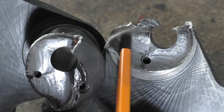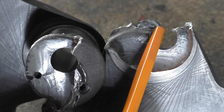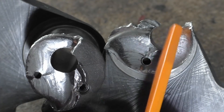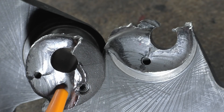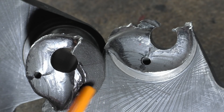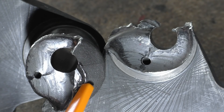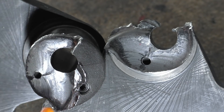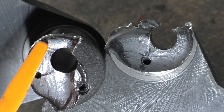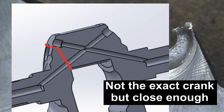We have a fracture, and the points of note — the points of interest — is that this hole is actually fractured through the hole, which is quite important. We have the oil feed hole here, and we're looking at exactly where it's fractured. It's fractured at this side here, and when we look on the alternate side you can see it tried to fracture towards this other oil passage — the cross drilling hole that's been blanked off. This breaching through this hole is also important. We can see there's a big curl of metal off to this side, and there's also a crack there as well.